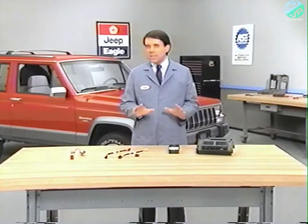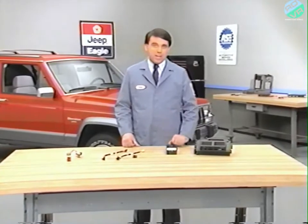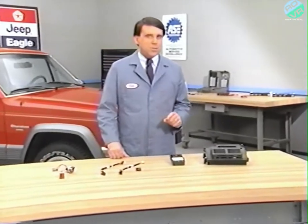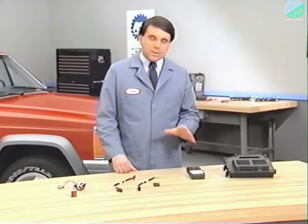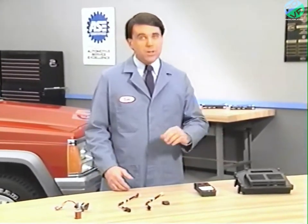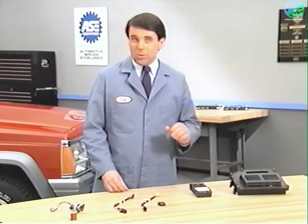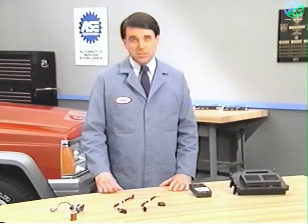It takes 20 starts for an engine controller to become accustomed to the presence of a SAM. The engine kill feature of the system will not function at this time. This is by design to prevent disruptions during the in-plant assembly process. Following this 20-start learning period, the engine kill feature becomes functional, and an engine controller that has operated with a SAM will not allow an engine to run without one. Keep this in mind when performing other service on these vehicles.